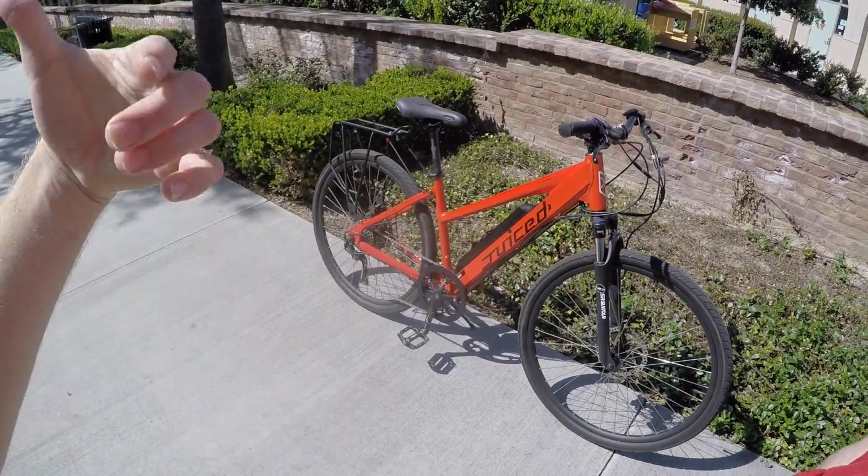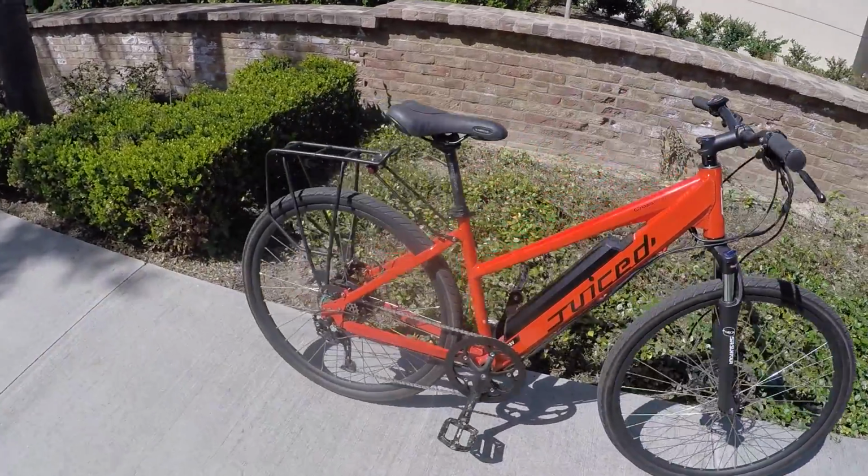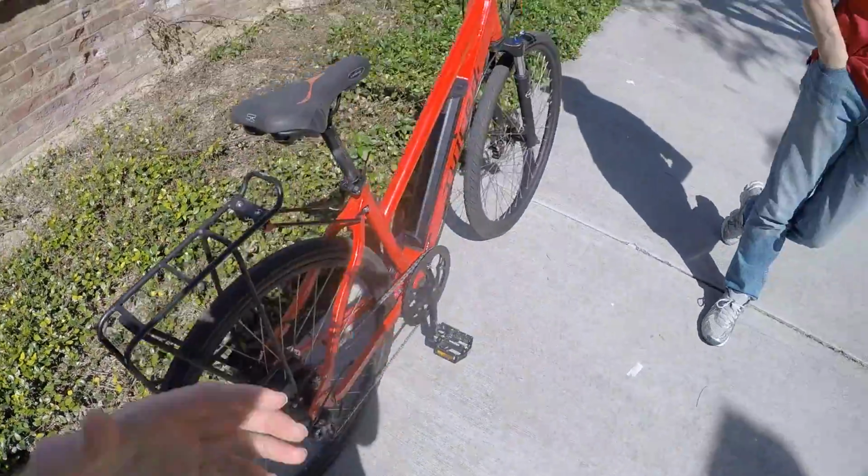The high speed combined with good braking, that's the other piece. What's interesting is it's torque sensing pedal assist, and I was like, oh, TMM4 sensor, and you smirked and you were like, well, tell me about that. What's the deal? It's like TMM4, but actually it has a cadence sensor as well. Okay. So you have torque and cadence. TMM4 is only torque. The cadence sensor is high definition, so you get 104 poles per revolution. Most cadence sensors are just 8. I assume this is a little more expensive. Why did you upgrade to that?